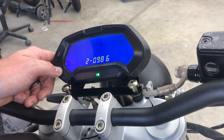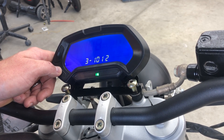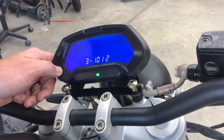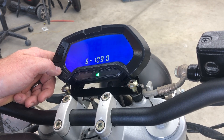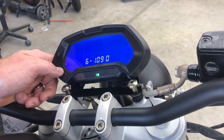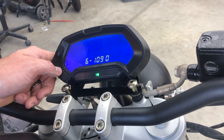It turns out I did not program it with enough accounting for voltage sag while riding, so I'm not going to change the first five charging values — charging voltage is consistent. 60 percent on charge, 80 percent on charge, and 100 percent on charge is past 108 to 109 volts. That really has no usable range; even on discharge, 108 is the highest that's anything useful — about 3.45 volts per cell. Anything above that on lithium iron phosphate is almost non-existent.